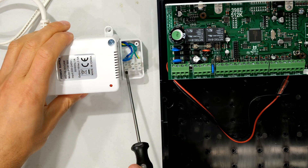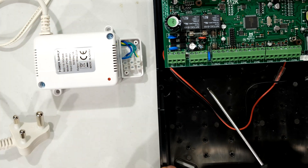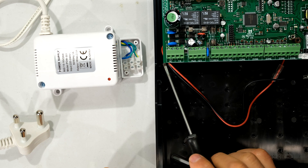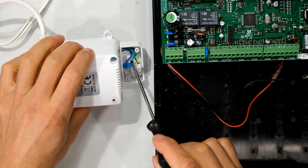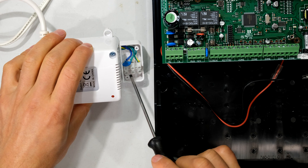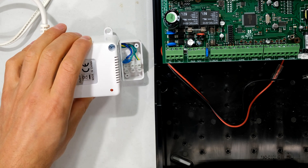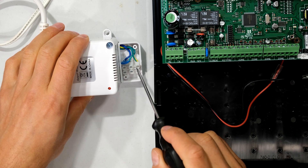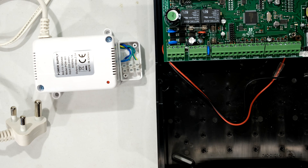Now I've unplugged this. We just need to connect two wires from the transformer to the panel. Because it is AC we are not worried about polarity — there is no polarity shown on the main board. The blue and green wires here should really have been black and black or black and red. Green is unfortunate because it often signifies earth, but the green-and-yellow is definitely earth, as I've just proved by measurement.